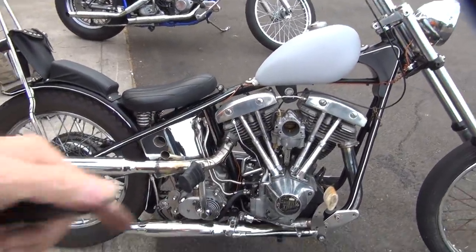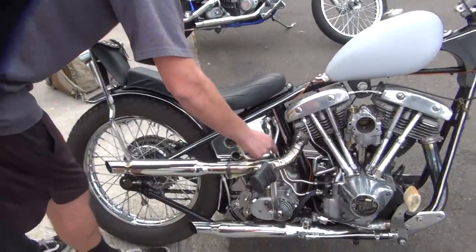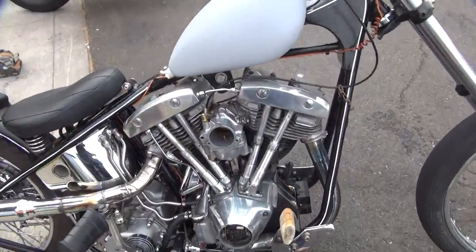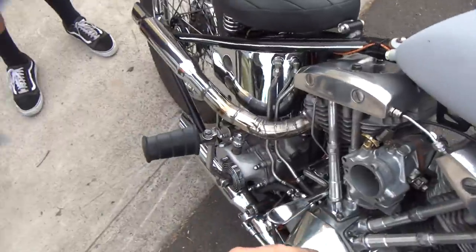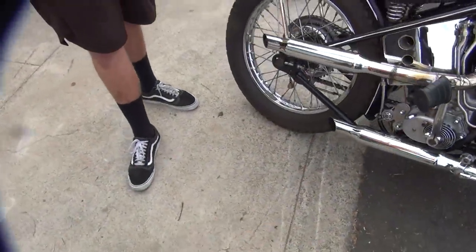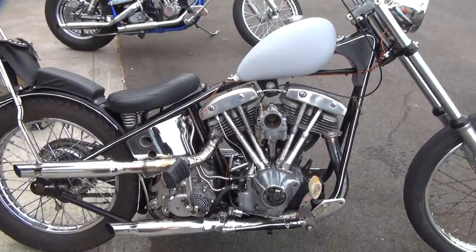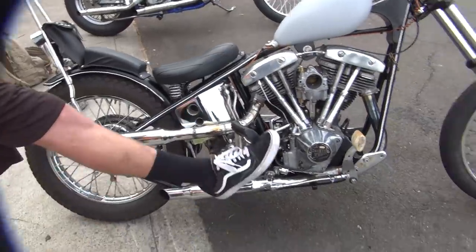Because it lets it go in nice and straight. Right now, it's going 90 degrees in turn, and it's all turbulent airflow. It's terrible. And with your leg right there, between your pant leg shutting off and how the air hits your leg and whether it goes in or out of the carburetor, it changes the fuel mixture curve big time. And with dog shit on my other foot peg, anyway, you got to figure out what you're going to do, and you got to adjust the mixture to make it work.